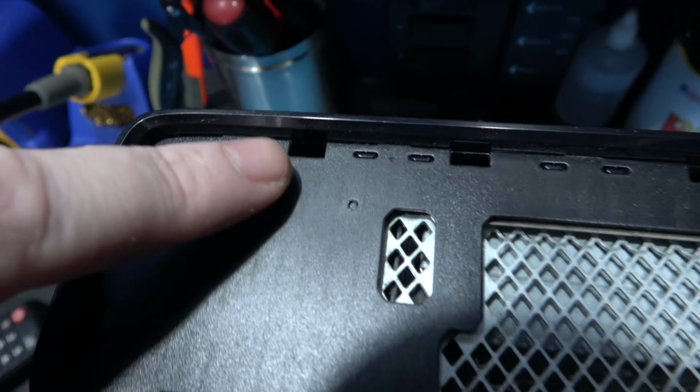What I want to do now is remove the fan, but first I'm not going to remove it like this, because I want to get it back in its case and get the screws back in that old X clamp down, because the last thing I need to do is start taking the fan off with this screw. And there's one on the opposite end there, and if I rock the fan like that, the seal breaks on the heat compound, and I'll have to re-grease it and then put it all back together. So yeah, I'm just going to get the motherboard back in its shell and I'm going to screw down the X clamp.